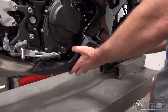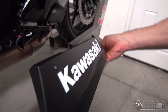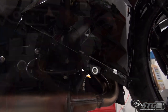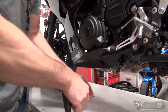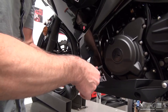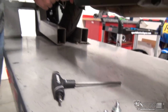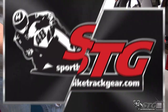Once you have your fasteners out, kind of tip it and roll it like this. You can see these two tabs go into the grooves. You have three fasteners plus the clip at the front. You have to remove the lower fairing so you can gain access to this fastener right here. Do the same over to the other side, then remove the trim panel. See the spacer? 4mm head — roll it up and release the tabs.